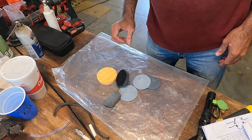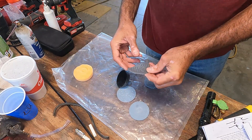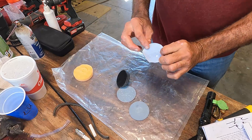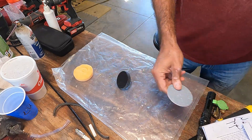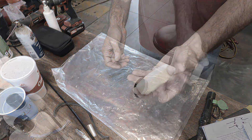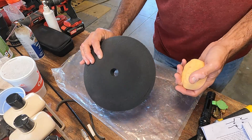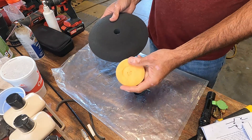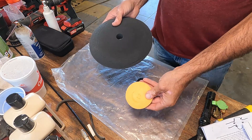These are the leftovers of a headlight restoration kit. In most of these kits you'll get usually around a 500 grit sandpaper, then an 800, and then this stuff - I think it's supposed to be 1000 or 2000 grit. You do your headlight restoration with the little attachment that goes into the drill. Here's our buffing pad for our big seven inch polisher that we use to restore and buff paint, and here is the pad that comes with your headlight lens restore kits - it's basically the same stuff.